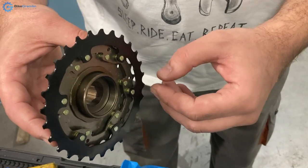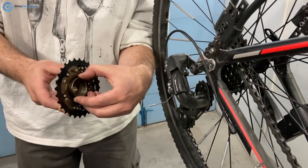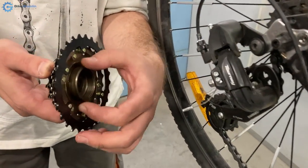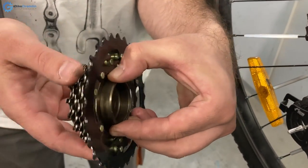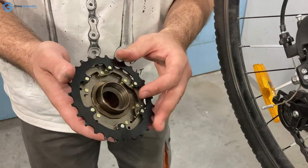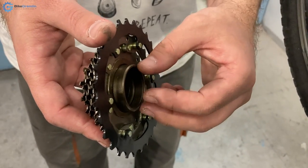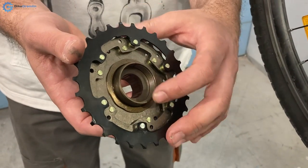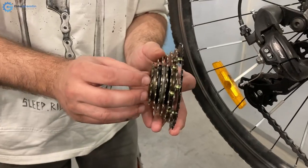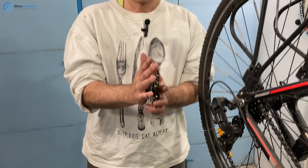When you engage and try to turn your wheel forward, it will also turn the hub. But when you want to stop pedaling and just coast, it will let the wheel spin forward easily without the sprockets turning. It will also let you pedal backwards with no problem. With this design, the hub and its bearings will end near where the freewheel is screwed on — there is no more room to put any bearings further out. The rest of the space is only the axle protruding to the other side, so you can install the wheel without the frame pressing directly against the freewheel.